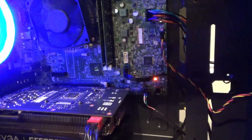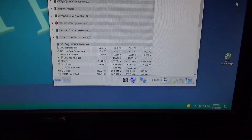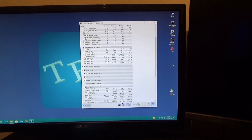I did finally get it to come up. I was under the impression I had to short pins — bottom pins two, one, and four — to stop the F1 error from the power button failure. That didn't work, so I'll try something else. For the time being she is up and running. I'm going to do a few tests and check temps. Right now with covers off, the CPU is 32–34°C and the GPU is 37–40°C. We'll see if that changes when we button it up.